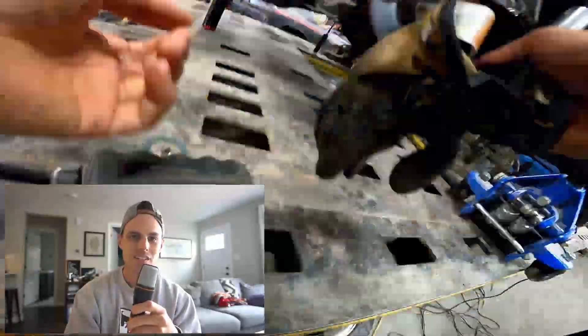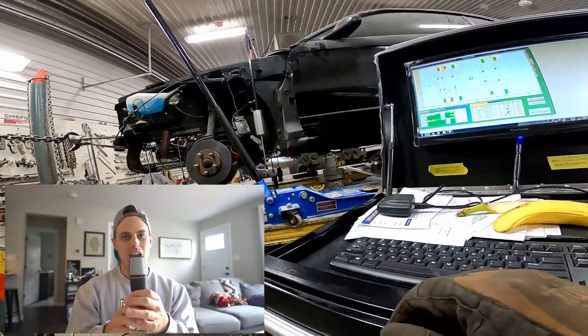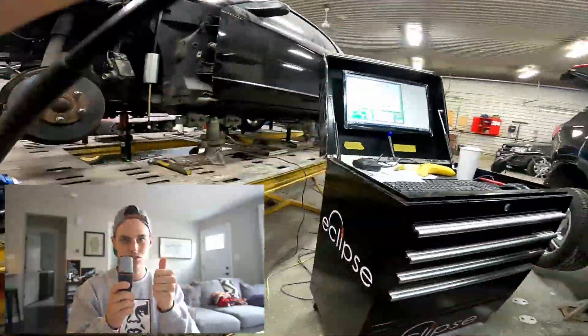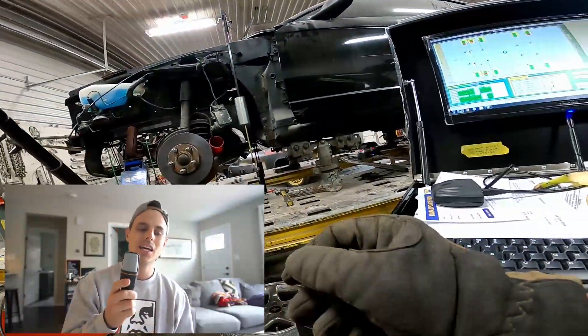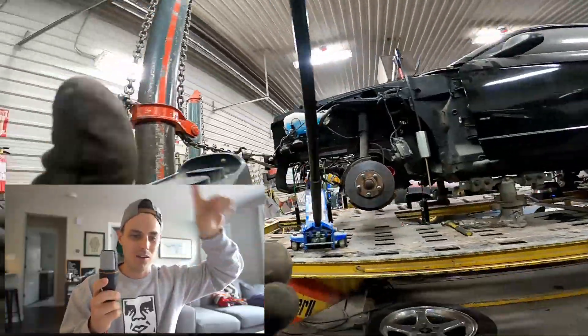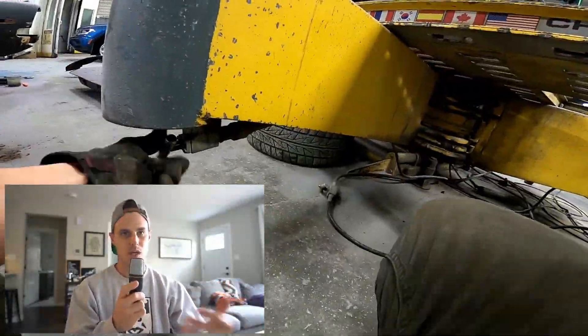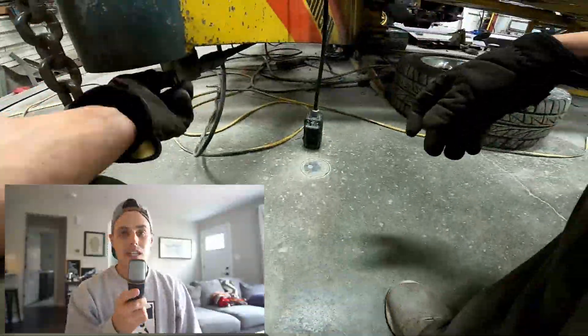Hey guys, it's editing Kyle here. Basically at this point I'd become so engaged with trying to repair the rails that I kind of stopped talking, and it's pretty boring content from here anyway. Once it's set up, I just had one tower pulling this way, another pulling that way, another going that way, and I was watching the screen and making tiny pulls — just pressing a button. The setup is really the biggest part. As long as you're pulling in the right direction, you watch your chain tension, and eventually I did end up getting it to come straight.